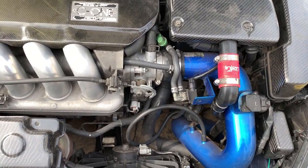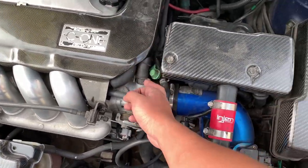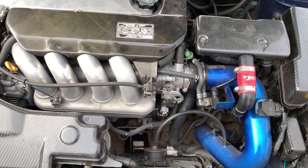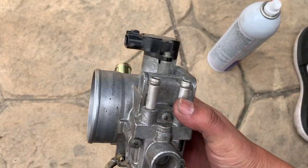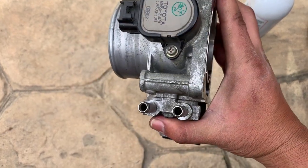I've got more stuff to take out — I gotta take out my intake and probably my valve cover because this hose needs to come off and I don't want to break it. So I'm gonna do that real quick, take all that stuff out and slap the new one in. Also want to mention — you do have two cooling lines right there which are kind of hard to get to.